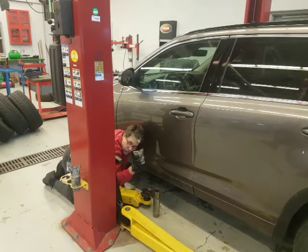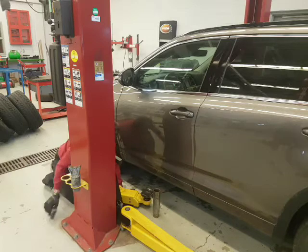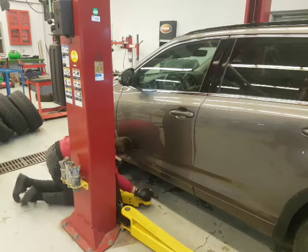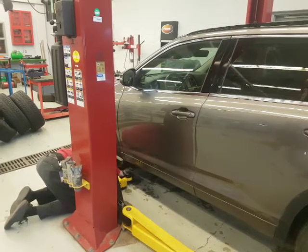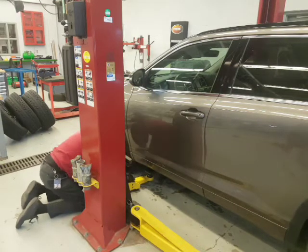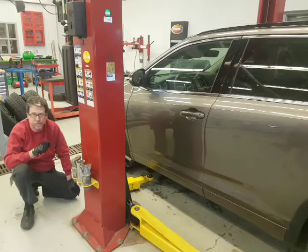This is for frames, so in my next video I'll show you what these are for, not this vehicle. So this one we don't need the truck adapter, we don't need the stack adapter. We're just going to use the pads to clear around. We don't have any running boards to clear. On this vehicle, I can see the 2 camel humps. So there's a crease, looks like a little camel hump. I'm going to go underneath that, spin it up all the way. I'm going to set all 4 corners, and then I'll be back to raise the vehicle.